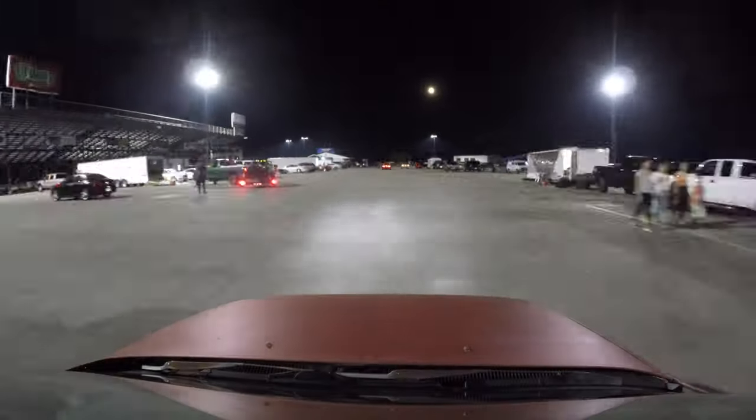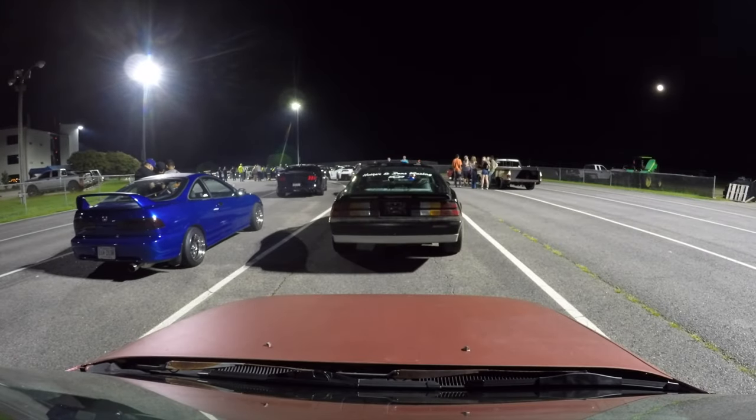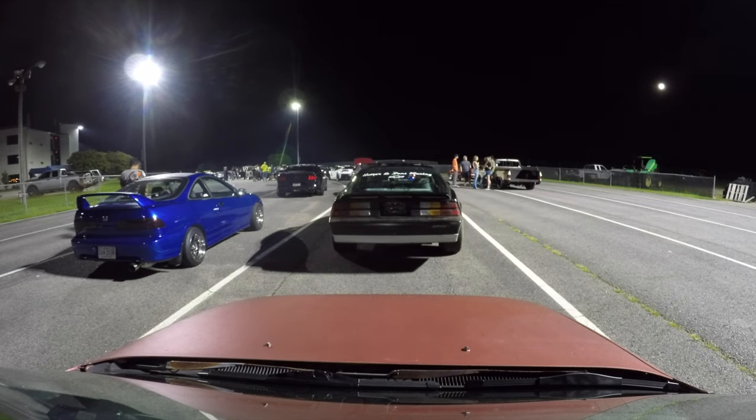In order to continue my night, I just repeated the values of the cells above the next 2 rows, turned down the boost a little bit more in first and second. And I said I did that earlier when I meant second and third, but this is really when I did the first and second gear changes. I lined back up again to try to see what it would get me, but it was pointless.